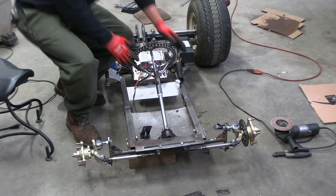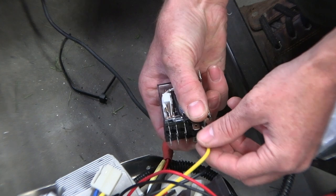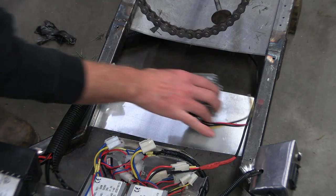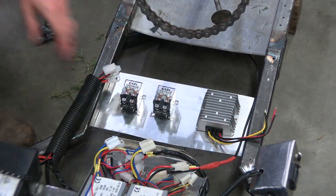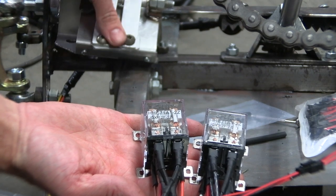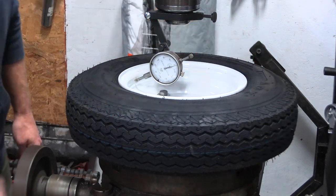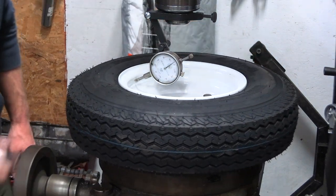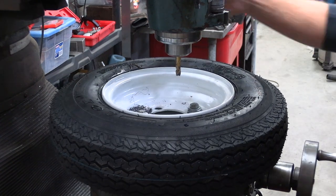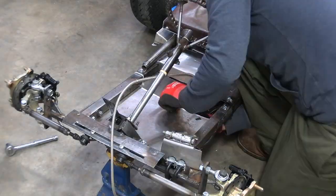I just have to undo the only bit of work that was done before I started — and not so bad. The next problem is that the reverse switches I installed keep burning out. I bought heavy-duty relays to replace them, but they run off 12 volts so I need a converter to install as well. Now that I've installed those new hubs I need new wheels and tires — any designed to fit the UTV hubs are massively too big. I bought trailer tires instead and drilled them out to fit. These tires are also a bit too big, but I'll worry about that after I install the brakes.